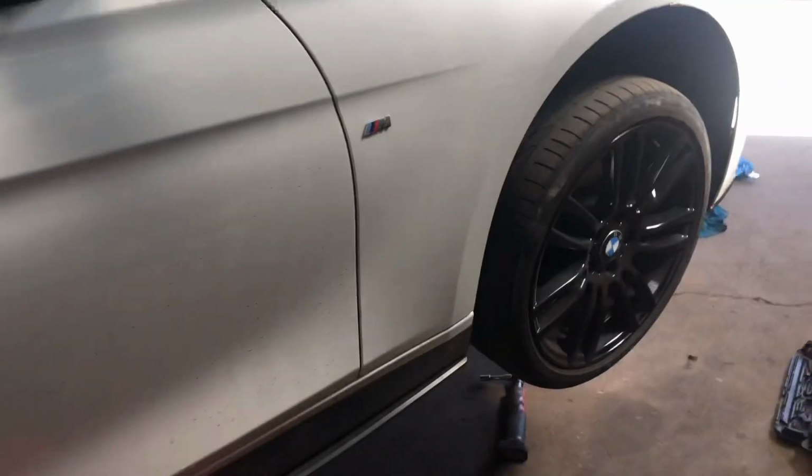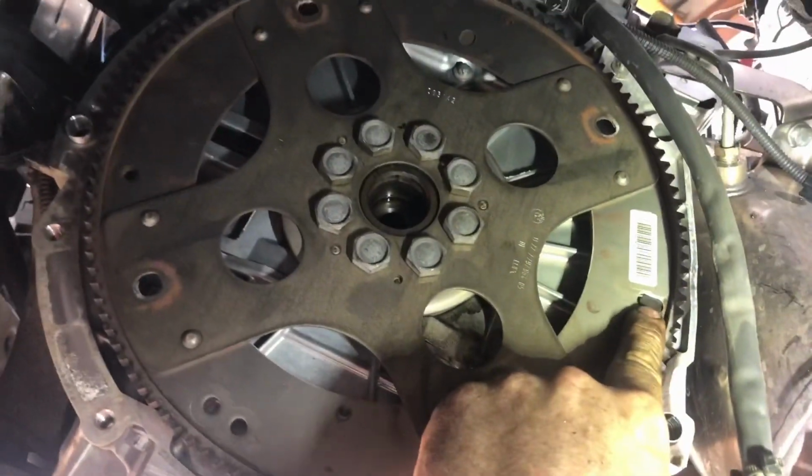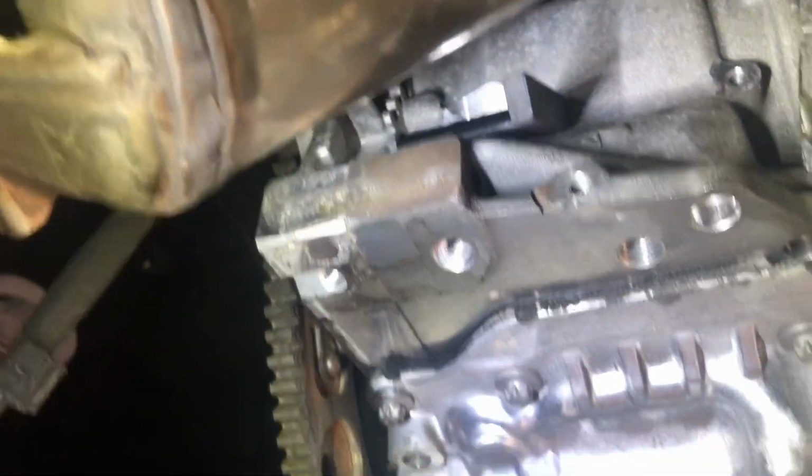And then if we look under the car, you'll see the box is out. Top dead centre is identified. Also, we know we're locked off because of this hole here, not the torque converter holes. There is a hole here, and your locking pin, which comes in your kit, goes in there, just above where the starter motor would have been.